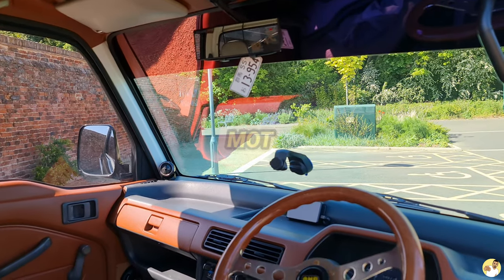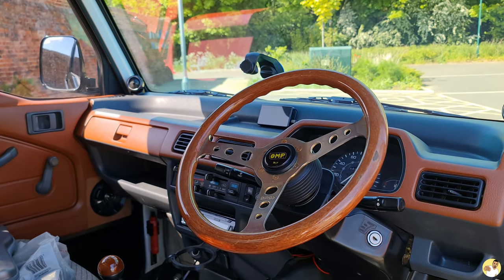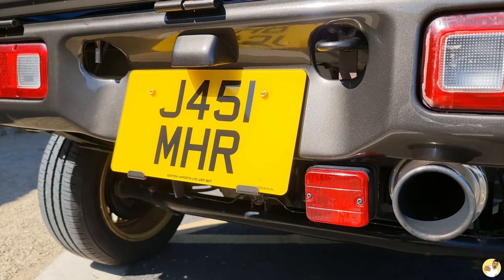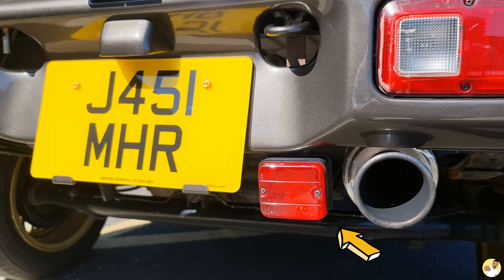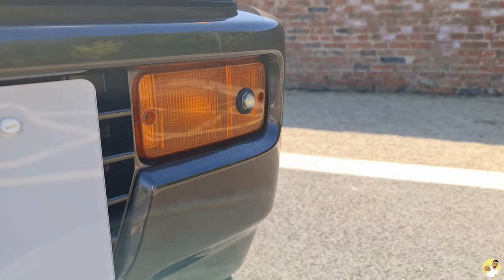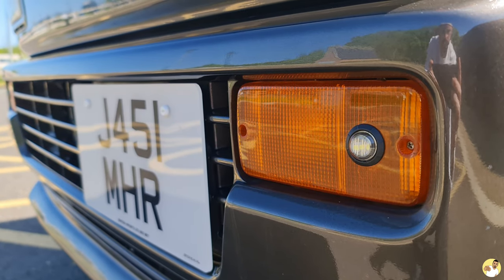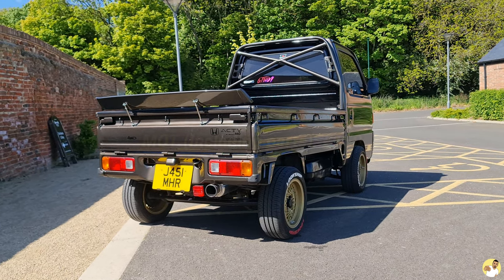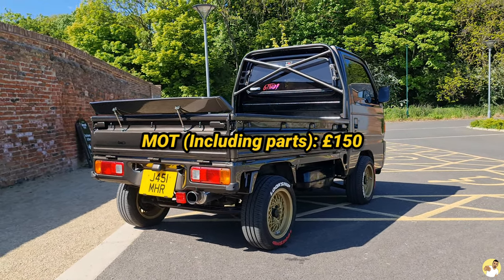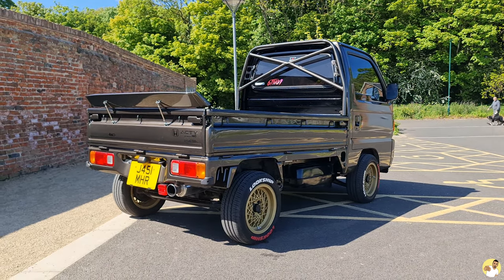The final thing you need to do is put it through its MOT. Richard at Ignition Imports was kind enough to do this for me so I didn't have to spend a penny, but if it hasn't already been done you will need to fit a rear fog light as that's a requirement here in the UK. You also can't have the amber side lights, hence why these little guys have been drilled into the existing amber lenses. All of that work including parts and the price of an MOT shouldn't set you back more than £150, and it will be a lot cheaper if you can fabricate your own brackets and wire the lights in yourself.